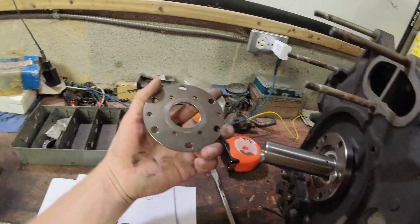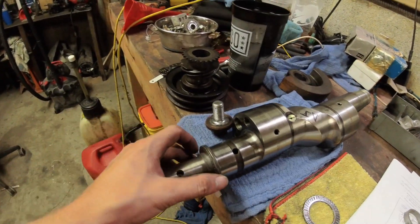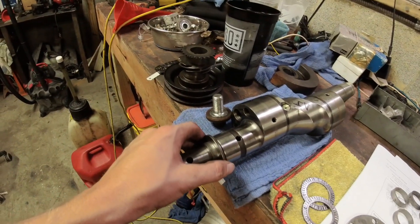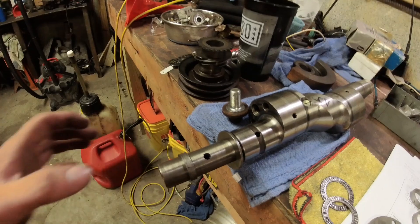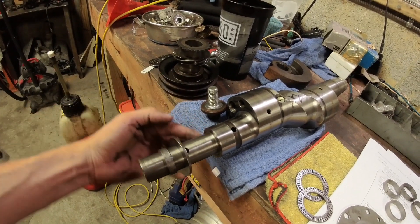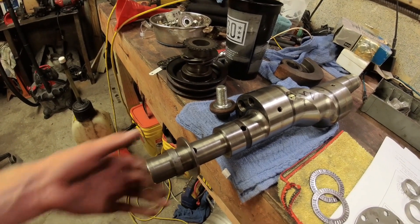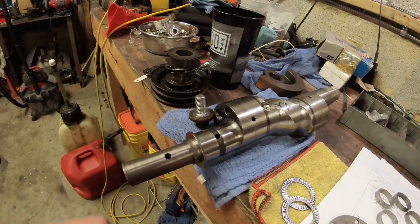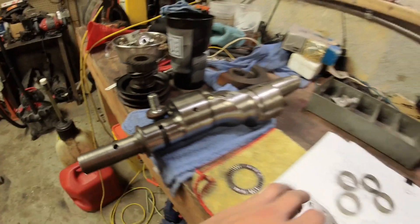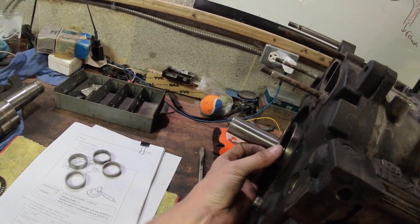Next you have your first of two Torrington bearings — take it out; they're not directional. This plate will come off but it's bolted to the front stationary gear. Everything taken off up to the plate's point comes off without removing the plate. Then you take the plate off, and next you'll have another Torrington bearing, then the spacer comes out, and the washer that fits on the front of your eccentric shaft comes out.